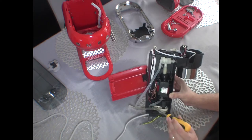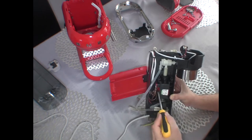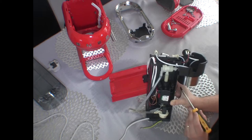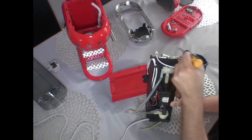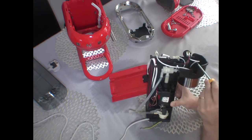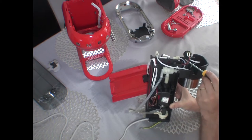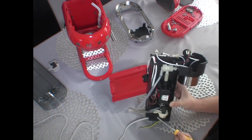Then the water goes through this line into the pump. Then these are connectors to the pump here. Then from the pump it goes to the valve. This valve basically works like a pressure relief. So if there is any block or any pressure increase in the system, past this valve, then the water, instead of going into the lines and then potentially spilling the hot water, causing some rupture in the piping, it will go back into the tank.